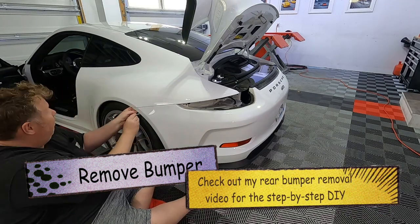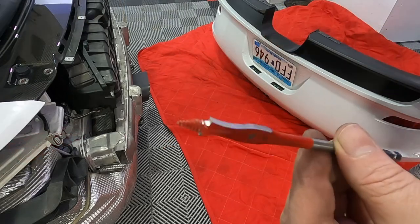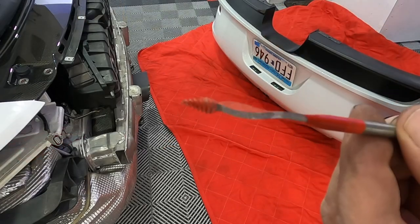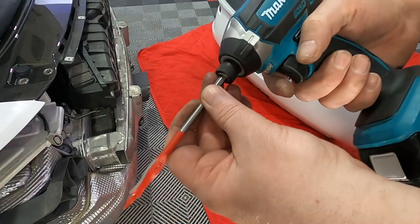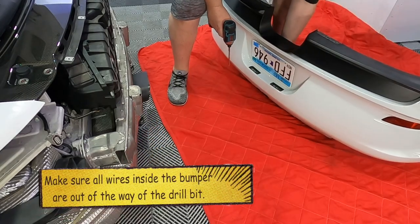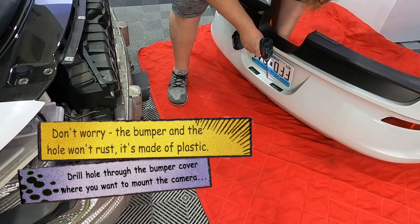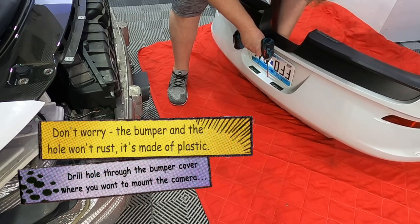Let's remove the bumper. And for the DIY step-by-step video, check out my channel. All right, we're gonna use this drill bit to drill a hole in the back of the bumper. This is a scary part for a lot of people, but don't worry, it's very easy. As long as you keep the wires out of the way underneath, so you're not gonna drill through and break the wire harness that feeds the lights for the license plate, you'll be fine.